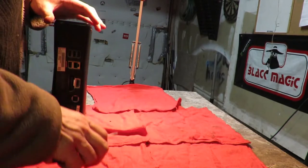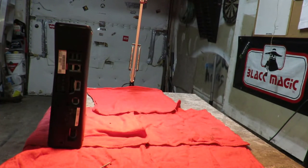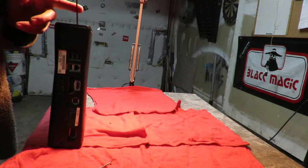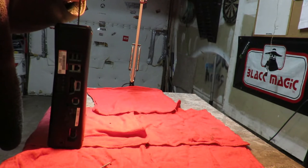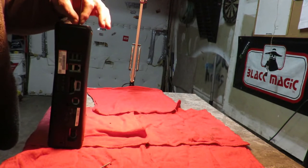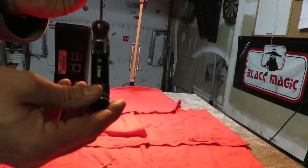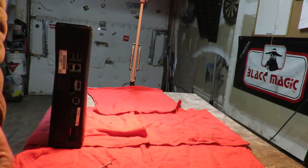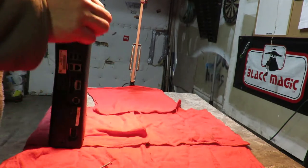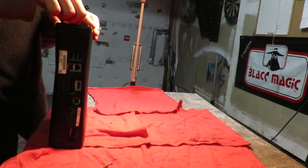This side's being a little difficult, so what we'll do is we'll do the other side. Now, there is also your Wi-Fi card in here. Might as well, while you have those panels off, take that off. It's one screw, which is a 2mm hex head. Keep that in mind, put that aside, and then you can just pinch it.